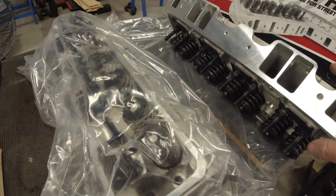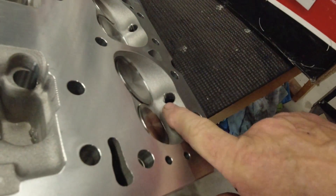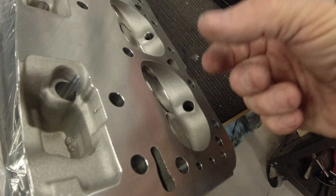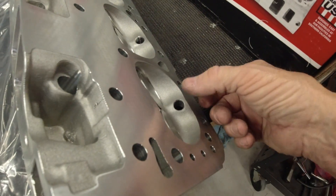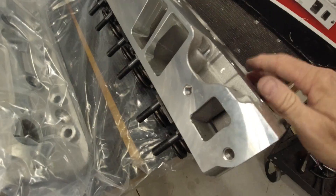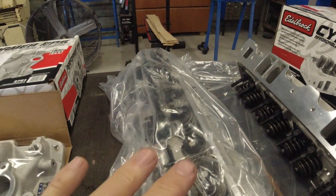The other thing I didn't think about until after I ordered — with aluminum heads, you normally use a spark plug that's got longer threads, because you don't want to rip those threads out. If you put a short spark plug in there and tighten it down, you might strip those threads. So they make them longer so they have more strength. I've got to find out which spark plug to order for that.